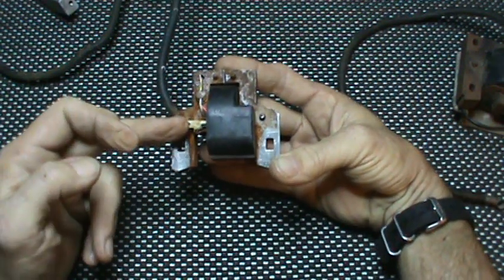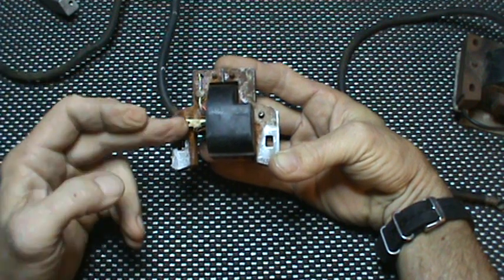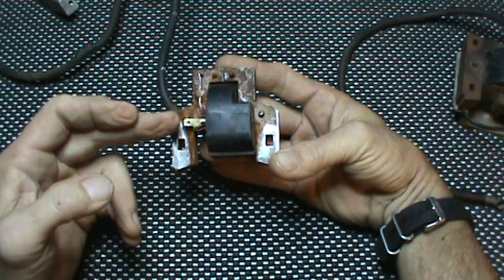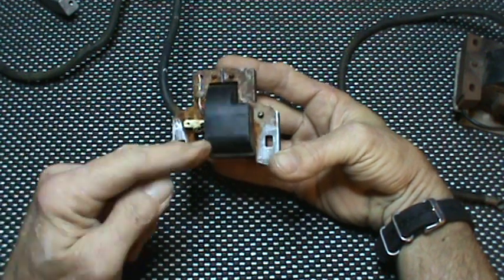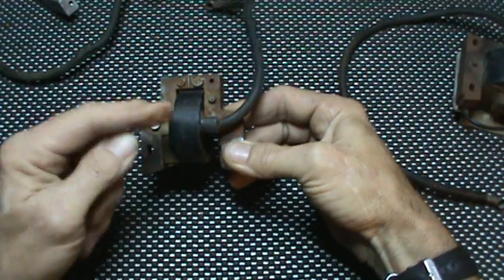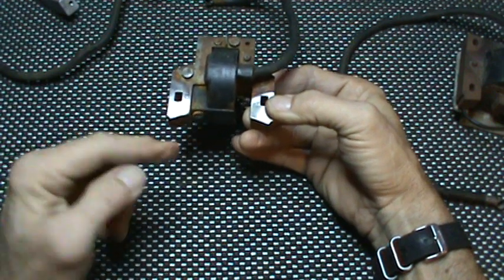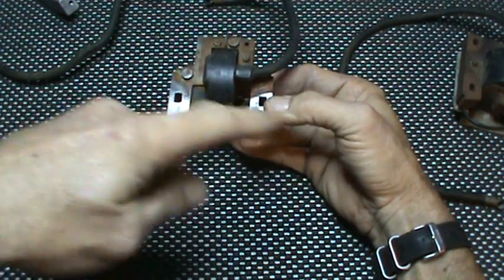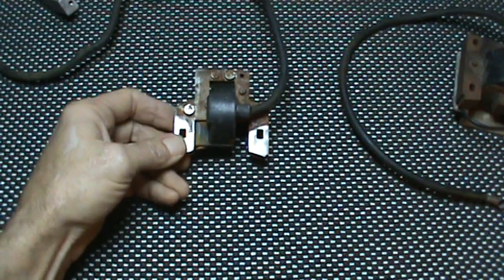This one just has a plug that goes from here for your ground to kill the motor. It says right here on this cylinder side, so it would mount that way — this side out on the magnetron. That puts your button to the left, which, as your flywheel comes around clockwise, is where it's hitting in order to open that circuit up.